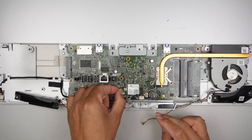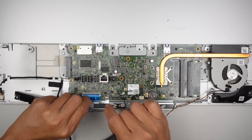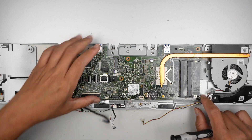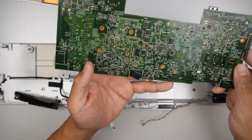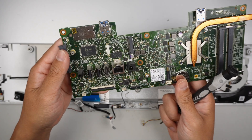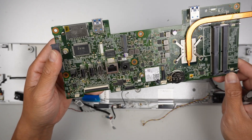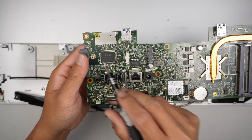The white and black cables are both for your Wi-Fi. This is your LCD connector — flip open the clip, remove that, and the entire motherboard should come right off. Also note there is an additional slot for an M.2 SSD if you want to add that.